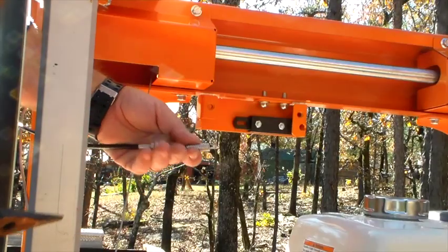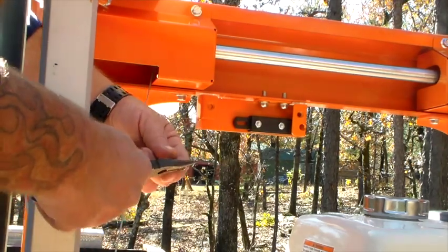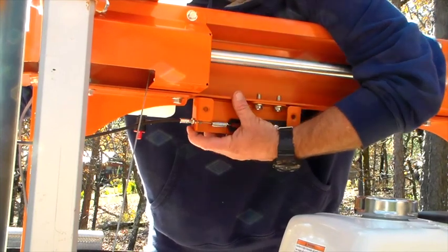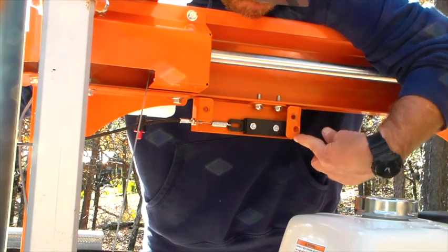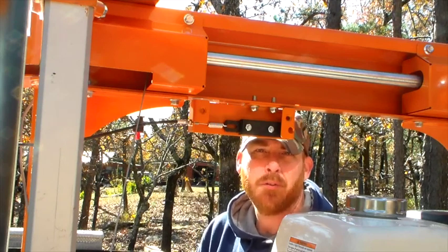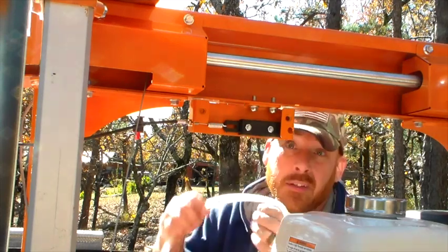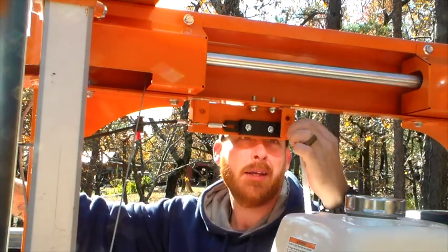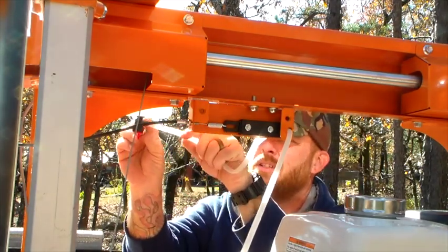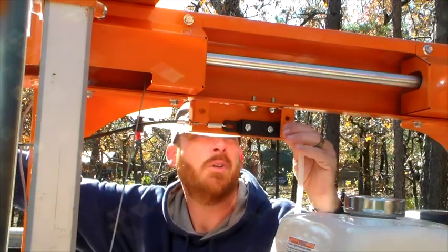Then take the other end and feed it through the keeper. The next thing, once you get your cable through your cable keeper, is to put the spring on the end — you've got to open the end up just a little bit. Once you've got your spring from your throttle cable on there and your throttle cable put in place, when you pull the throttle handle this is what should happen. The water line they provide is longer than the one in the original kit, so we're going to reinstall the water line with the new one. Come up to your bracket, open your valve, run your line through it, and then just over to your on-off.